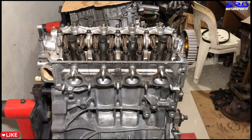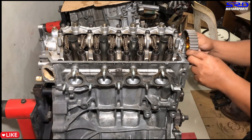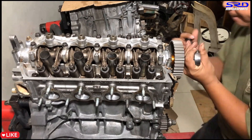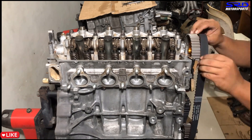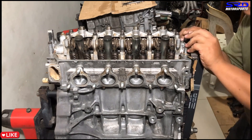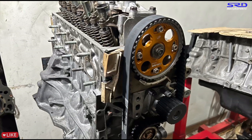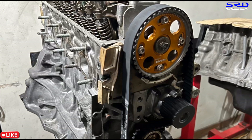My colleague is completing the belt, tensioner, and plastics — getting the backing cover behind the cam gear so the head is really complete and looks clean. The belt is on and we're checking the VTEC cam belt tensioner. We set this at 109 lobe center, which is what Crower suggested. This engine is basically finished.